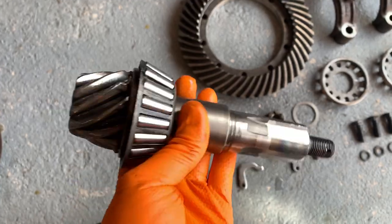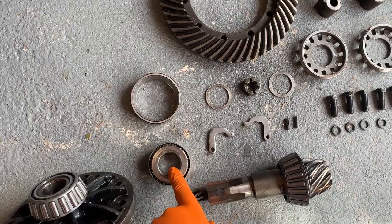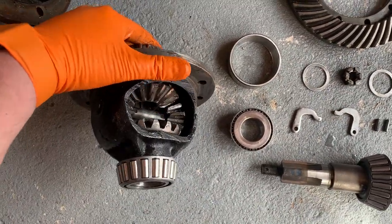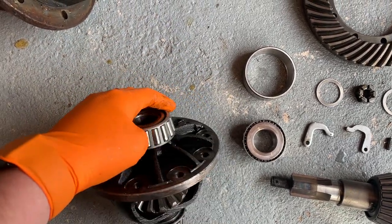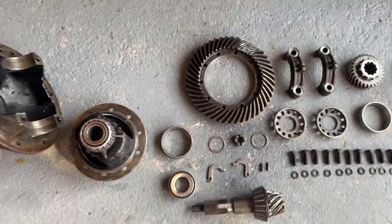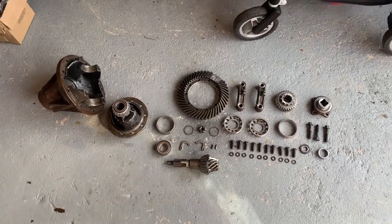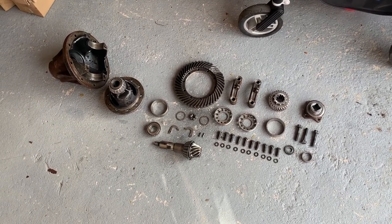There's no point keeping the left bearing, so I need a new one of those. Pinion and crown wheel - nice and cheap, not! The carrier is absolutely fine. Spider gears look to be okay too, but I will take them out and degrease them also, and replace these bearings now that they're full of muck from the degreaser. If you're going to do a job, do it properly. The ethos of this channel is to try and do everything to as high quality as possible, but also to keep the costs low. I'm not a mechanic, but I do try and show you how I would do things.